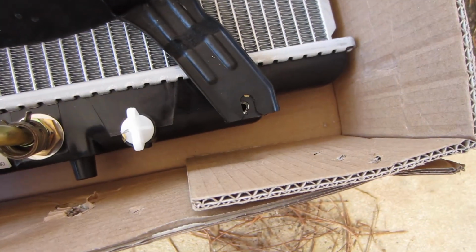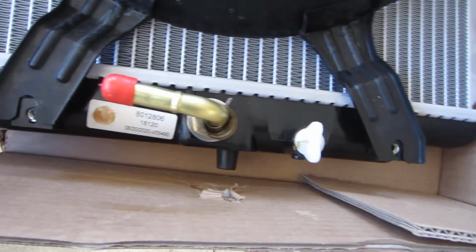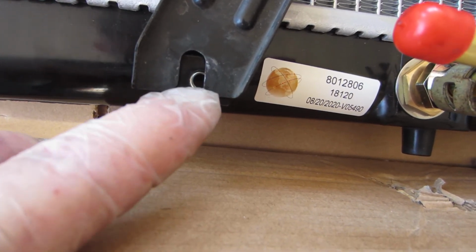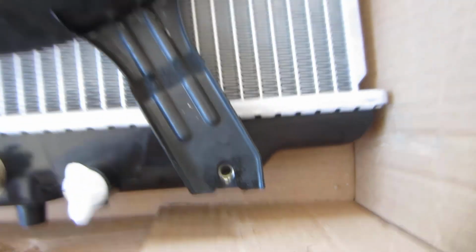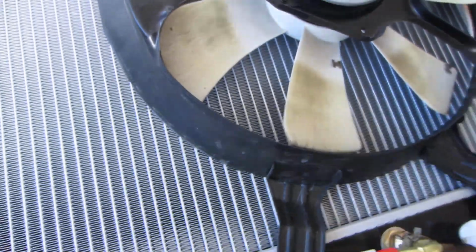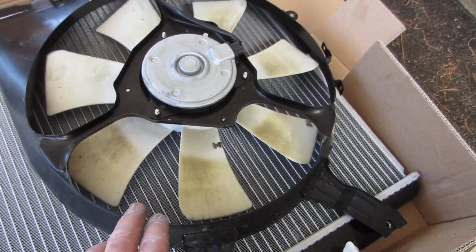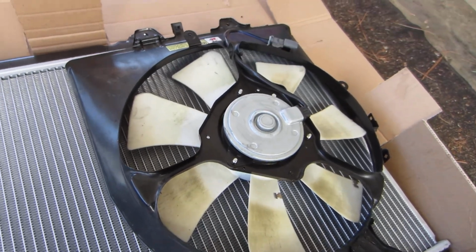And you'll notice that the aftermarket unit, the holes don't line up real well. In fact, the mechanic that did the work on it last time had left this bolt out, and I'm assuming it's because the bolt just wouldn't go in, because if you line up all the rest of the bolts, that bottom bolt won't go in. So aftermarket fan unit and aftermarket radiator. But actually, the original fan unit went out. It's what caused the compressor on the air conditioner to go out also.